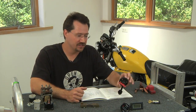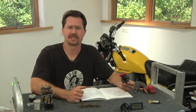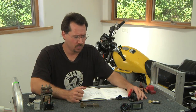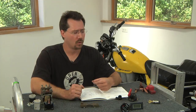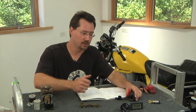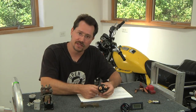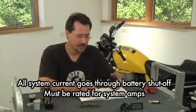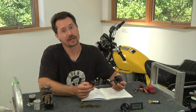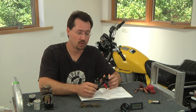Another important part is a battery shutoff. I like this style plunger key — these are really common for boats — to just be able to disconnect the batteries. This is a great way to make sure the motorcycle is completely shut down and powered off when the vehicle is stored or you're showing it off at a car show. All you need to do is pull out this key. It's a device where all the current runs through it, so make sure it has the correct amperage rating for your application. A lot of these look similar but the cheap ones are not rated for very high current, so always make sure all your components are rated for the appropriate level of current.